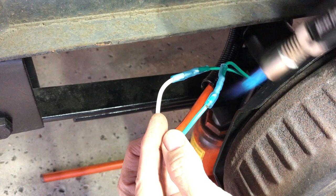I've pulled both wires out of our axle tubes and I think it's safe to say we found ourselves a smoking gun. This is just one example, but right smack in the middle of the wire, this wire — just from dancing around inside the axle over the years — has worn all the way through. That's bare copper wire touching the axle tube. There's your short circuit. I've got several of them on both cables, so we can positively identify the cause of our short circuit. Lesson learned — I salute manufacturers like ALCO who try to protect the wires, but as you can see, their protection was ultimately the cause of the short circuit.